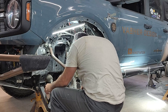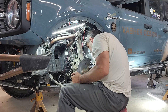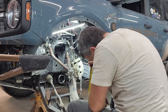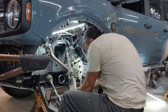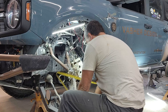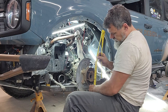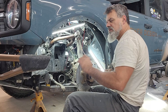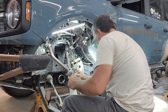We're going to bring this all the way up and see where this lower control arm ends up. We're all the way up and limiting out on the upper control arm. Let's check our travel — measuring to the bottom stud: seven inches from the ground to the center of that stud at full droop, and twenty-two and a quarter inches at full up-travel. That's fifteen and a quarter inches — we'll call it fifteen inches of travel.